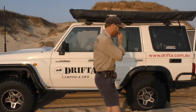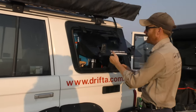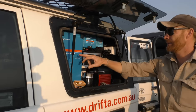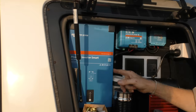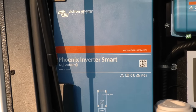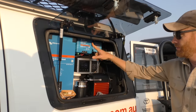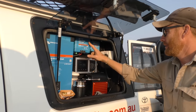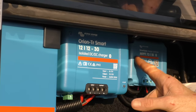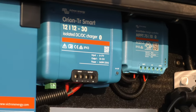Clodagh's already installed this window box. We had an 800W inverter but we've taken it out and put in the larger Phoenix 2000W inverter. This Victron gear is just next-level stuff. We've gone for the big 2000W inverter, the Victron DC-DC 30 amp, and also an MPPT controller for a little solar panel on the roof — 115 watts running all the time.